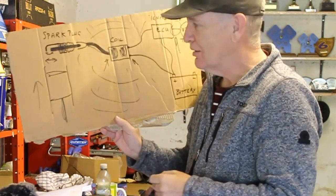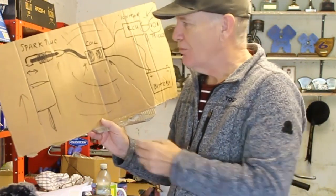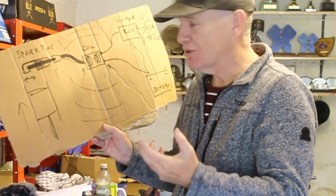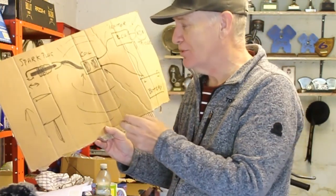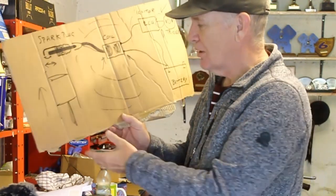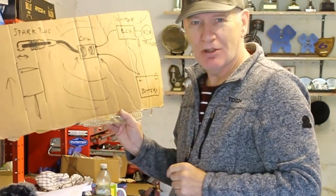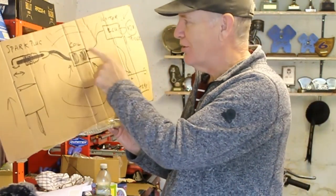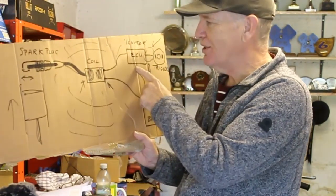The coil itself can also fail. Inside you've got the primary and secondary windings, but the coil body is essentially a large plastic barrel or drum that can crack over time in the harsh environment, and that can cause the spark not to happen where it should at the end of the spark plug. Similarly, as usual with a motorbike, all the connections can fail — they can corrode, vibrate loose, and insulation can fail — so if you have a problem you've got to check all of these as well.